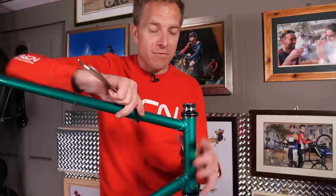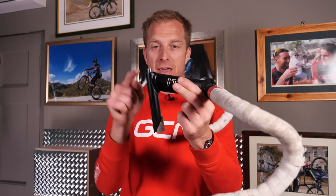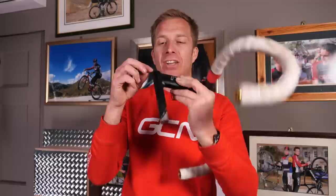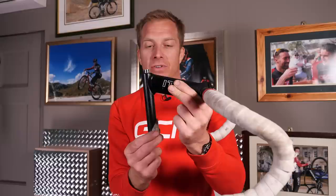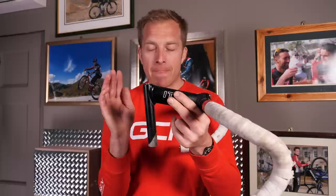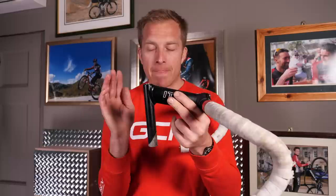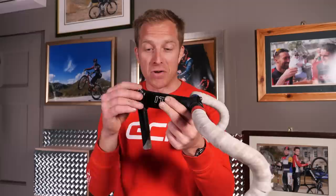This is where we use a quill stem. You can see a wedge system and a bolt — the bolt threads into the wedge. As you tighten the bolt, the wedge gradually creeps upwards on the lower portion of the quill and wedges inside the steerer tube of the forks. It's a kind of interference fit. It was around for donkey's years and is still on plenty of bikes. The downside is that quill stems can easily become stuck inside a fork steerer, which is an absolute pain unless you use lots of grease in the first place.